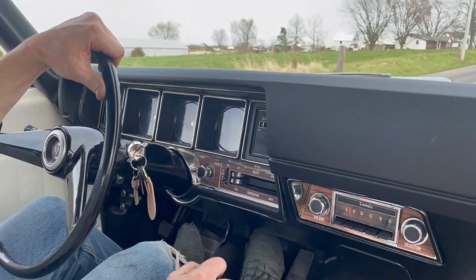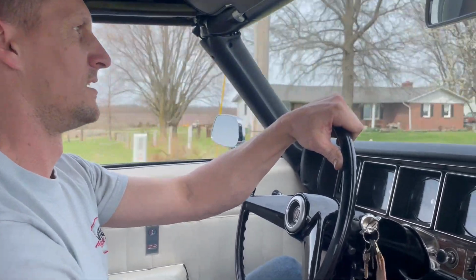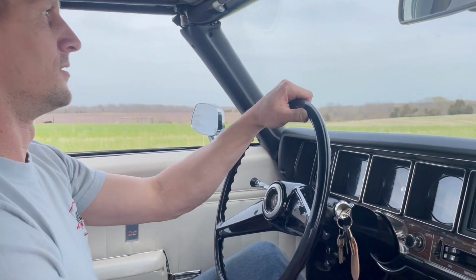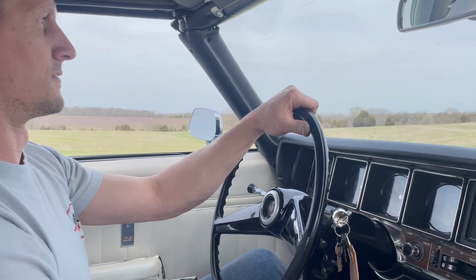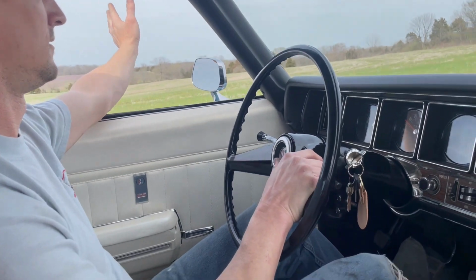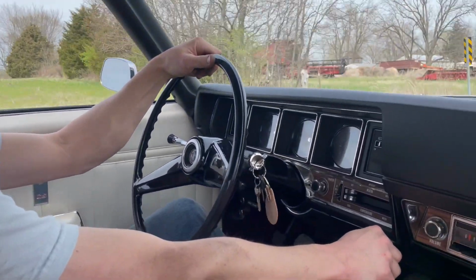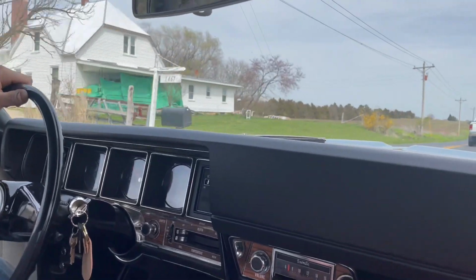A little bit of detonation in wide open throttle. Check timing. Probably has a little bit of bad gas still in it. I put 10 gallons of good stuff in before we got on the road, but usually it takes a little while for that stuff to go away. Can we do that again? As soon as we get rid of this truck, we will.